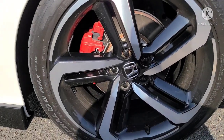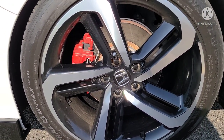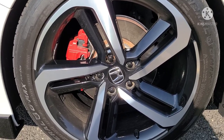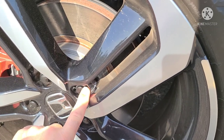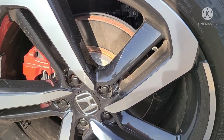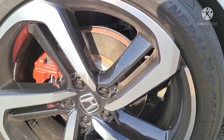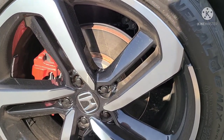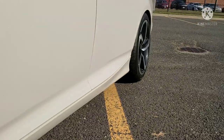The issue you're going to have is if you want to go with an aftermarket wheel and get the right fitment, you're going to have to change these studs out. With 20 millimeter spacers you have to cut the studs. If you go 25 millimeters or more, you won't have to cut the studs. So if you're going 15 or 20 millimeter, like me, you had to cut the studs in both the front and the rear.